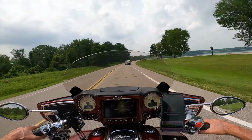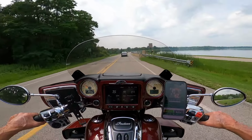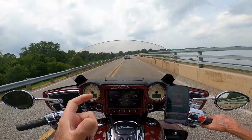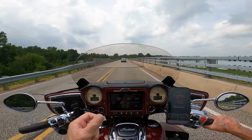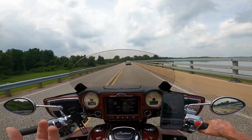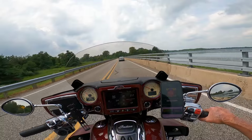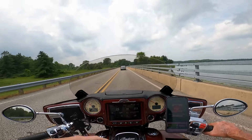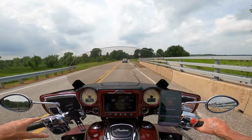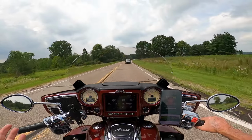It's just heavy. So that tour pack has power locks, 2 power locks that are driven by one solenoid. That solenoid has a plastic sleeve on it, and that plastic sleeve broke. So they replaced that whole unit. They didn't have to replace the whole thing, but that's the way it comes. They don't have just the solenoid, they have the locks and everything, so they replaced that. All of that was done under warranty. So other than that, I've had no major warranty issues.